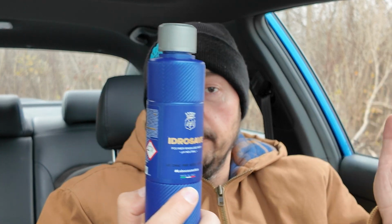So a lot of you have been wondering what the heck a 3pH rinseless wash is. It may seem confusing because you thought 3pH was the pH of the products used. But it's actually a wash system that Labocosmetica trademarked. It simply means a high pH wash, a low pH wash, and then a neutral pH wash. 3pH. Seems simple, right? So Labocosmetica came up with the Preludio Alkaline, which is the first pH. Then they came up with the Preludio Acidic, which would be the second pH, to go along with their rinseless, or their third pH.